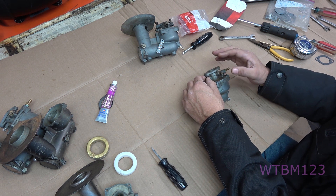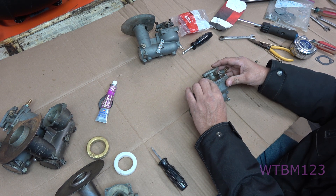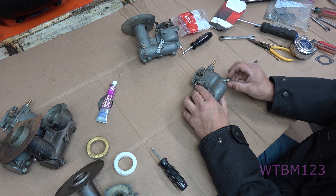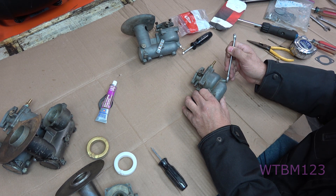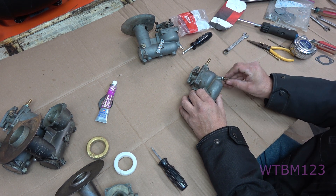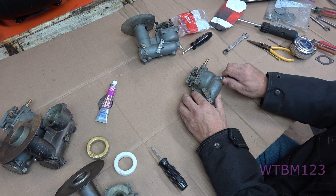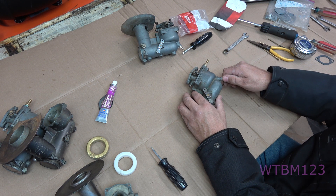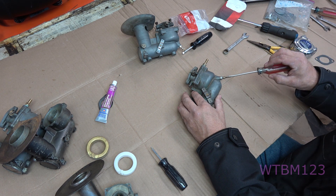On this top idle jet, it's only one turn out usually — a turn and a half is just a starting point. This one has a spring and no washer. Put this in there and snug it up with a 7/16 wrench — snug but don't strip the threads. Run this jet in by hand, and the same as any jet on a carburetor, run it in by hand. As soon as it gets tight, stop — if you don't stop you'll cut a ring around that tapered part of the jet and it won't be right after that.